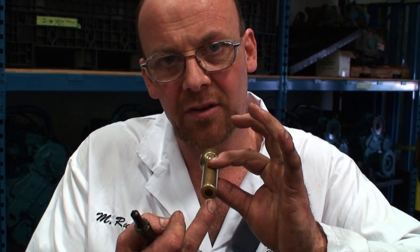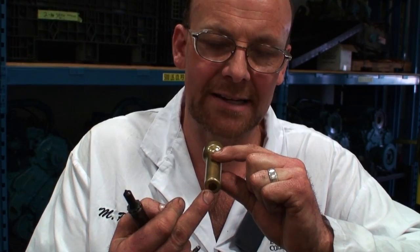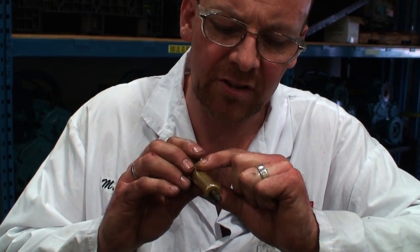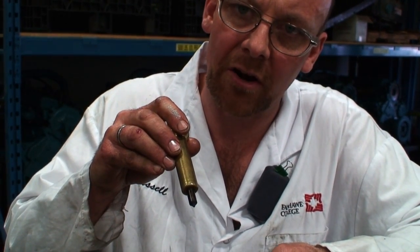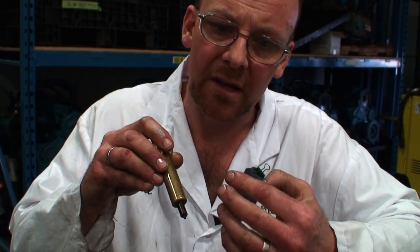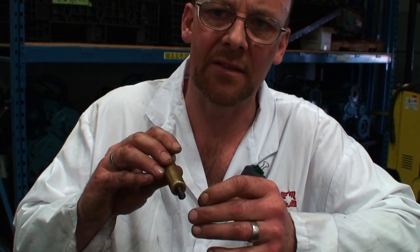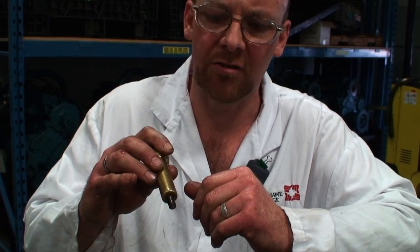Now there's also a lot of heat right here. This particular manufacturer uses what's called a direct injection injector. When it's installed in its correct position in the engine, it actually comes through the sleeve through the head boss and then is in the combustion chamber area. On a diesel engine, the combustion chamber area or the clearance volume is made up by the relief or the bowl mixing bowl area of the piston. In automotive applications, we tend to have the combustion chamber in the cylinder head, and sometimes it's part of the makeup of the piston head in combination with the cylinder head.